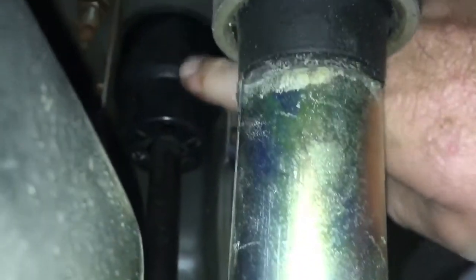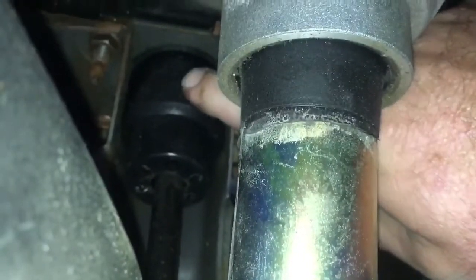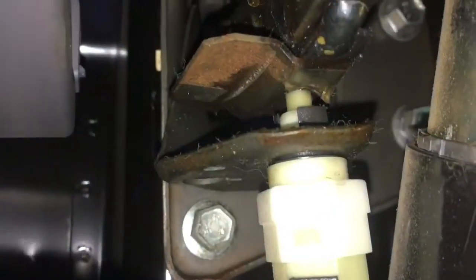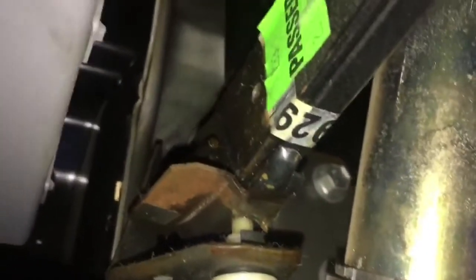This is the booster shaft - that hooks up to your brake booster on the outside. To get that out of there the booster will actually have to be moved right back out of the way. First off, get all four bolts around the booster off and get that clip off. There's also some silver bolts - three of them - that are hard to see under here. Get your hand up in there and feel for it. Also unplug the brake switch. Then we'll get outside and show you what to do with the brake booster to get it out of the way.